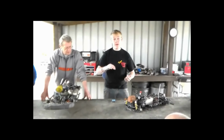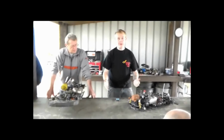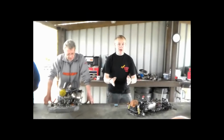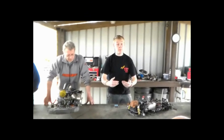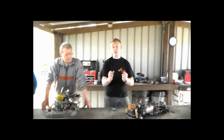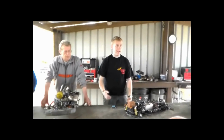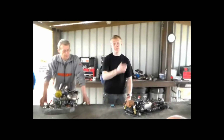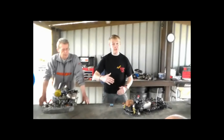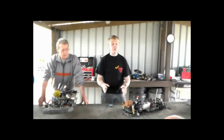It's all about coming out of that corner, and most times we don't really change the rear camber because you can change it, but it changes the car performance quite heavily. So it's not something you want to do if you need a slight bit of difference on the rear end. That's where you go to rear toe. But if you change the rear toe and the rear is still going, no, I want to slide out, then you maybe go, okay, I'll change the rear camber, or you change the rear shock position. But yeah, the rear camber is something you tend not to really need to touch.